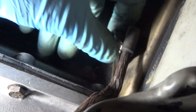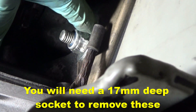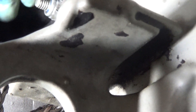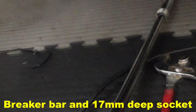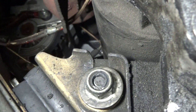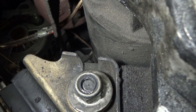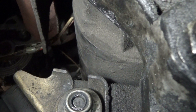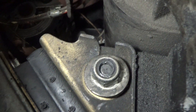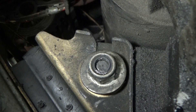The first thing you've got to do is loosen up this bolt and actually remove the whole thing. On this side you have a nylock nut and a washer in addition to the ring terminal for the wire. I've already loosened it up — just get yourself a breaker bar and loosen from behind. Behind the engine mount you can see there's a standard nut and washer. Don't try to take the nylock nut off; it's better to take the standard nut from behind, then pull the entire threaded rod out and slip your new terminal over that.